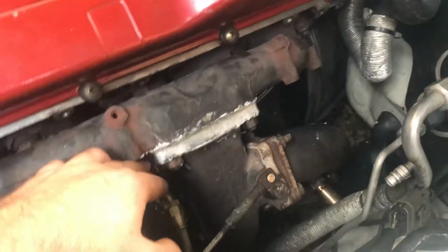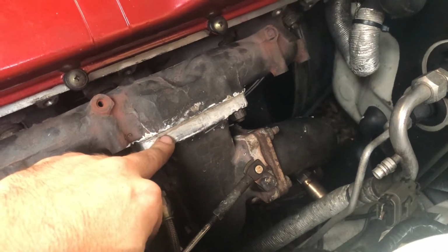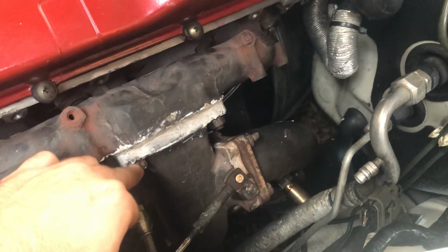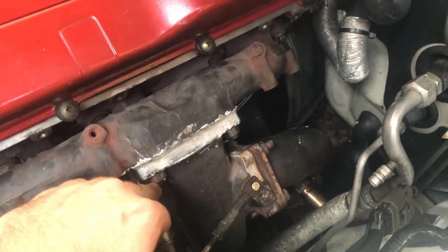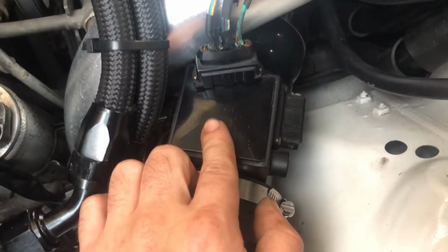So we also had a little bit of an exhaust leak on the car, and at the time I was a bit frustrated. I thought, fuck this, I'm just going to absolutely cover this thing in exhaust paste to kind of get rid of the issue, because I think the gasket on it is a bit too thin and it pulls it in too close, so the studs kind of bottom out on the shoulder of it. So another day I'm going to get a thicker gasket on here, put some washers on here if we have to, and solve that another day. But for now, it's function over form, because we've got a lot bigger issues, and hopefully it's down to this